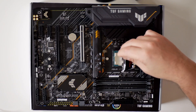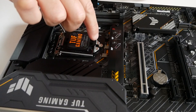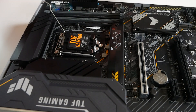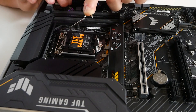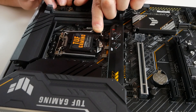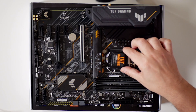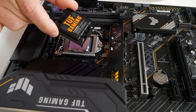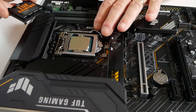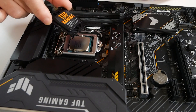When this is done, we can lower the top again — you'll see that these little teeth at the bottom, or metal extrusions, go underneath this section here. Move the lever down slowly and you can see it is on there; you'll hear a bit of creaking as this goes on. Bend the pin out and then back under, and you should find that the actual cover itself has removed itself — it just pops off. Keep this to one side; if you do have to return the motherboard for an RMA, you will need to replace this cover.